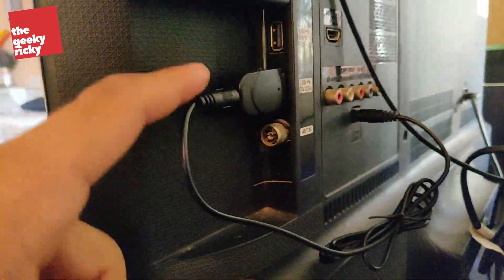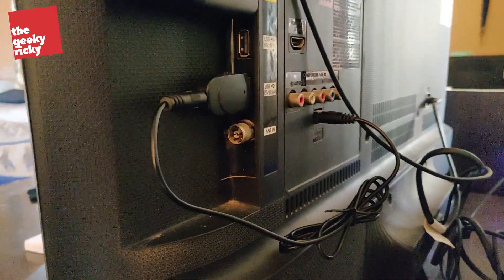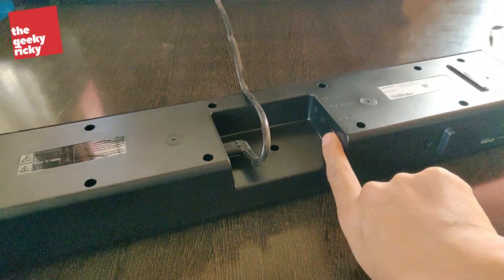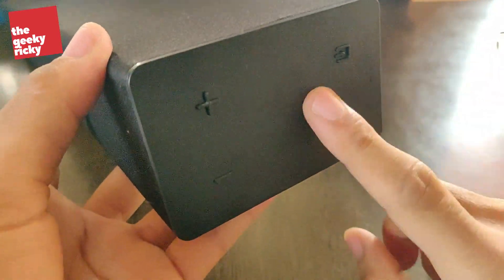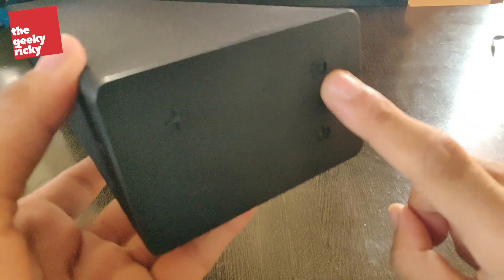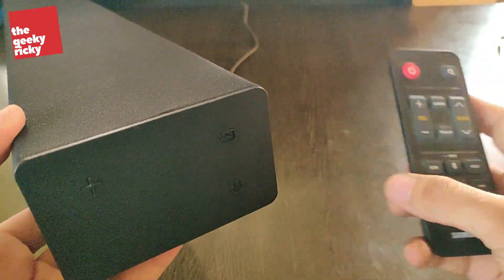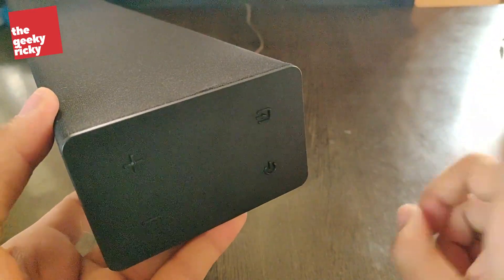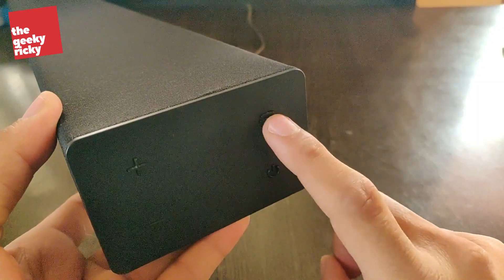Once the device is connected to the USB port and the audio jack of your TV, you just have to turn on the Bluetooth on your soundbar. On the side of the soundbar you have buttons to volume up and down, and one for choosing the connectivity option. You can also toggle this from the remote, but what I found is that pressing Bluetooth on the remote normally does not connect. What you have to do is select the Bluetooth option and press that button for about five seconds so that the soundbar syncs to the Bluetooth device.